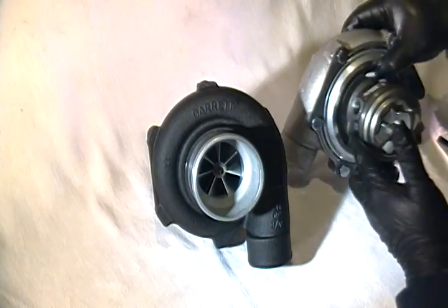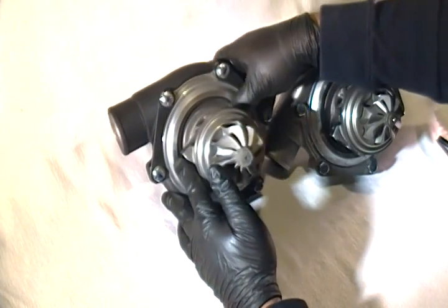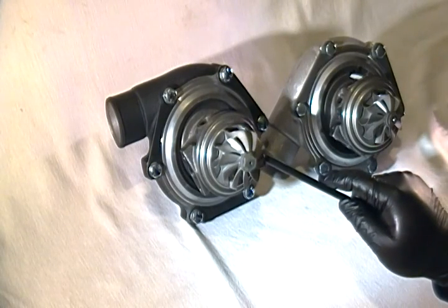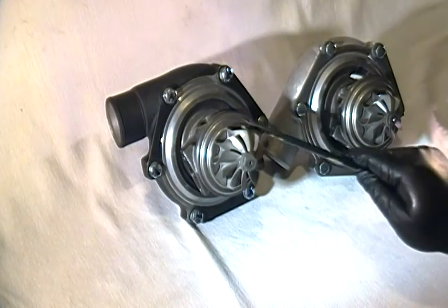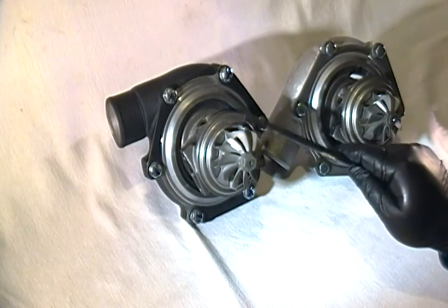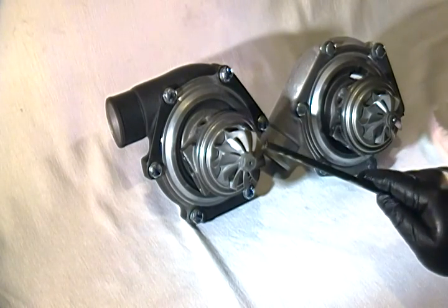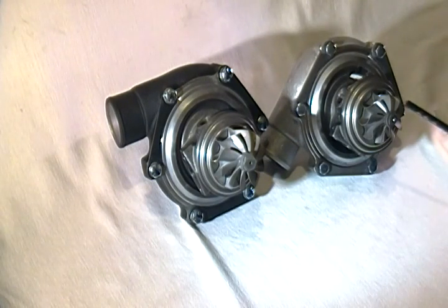The key difference is the turbine wheel: the GTX 2860 uses a smaller 54mm turbine wheel versus the N111 60mm of the Banshee, meaning turbine housing changes are required when upgrading to this turbocharger. Where the GTX 2860 maximizes torque in the mid-range up to about 5,000 RPMs, the Banshee's larger exhaust wheel and compressor wheel profile extends that by at least 2,000 to 2,500 RPMs more — delivering more top-end power, still great mid-range, and very little spool change compared to the GTX 28 series.